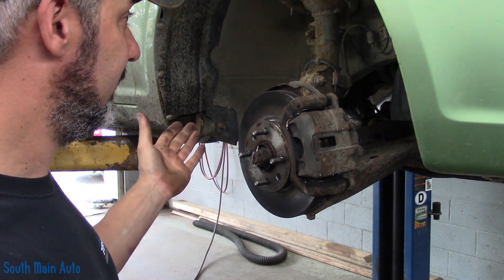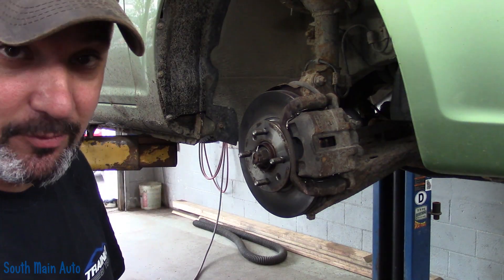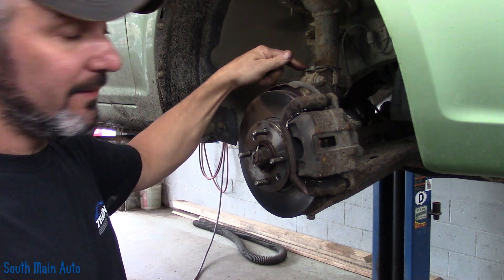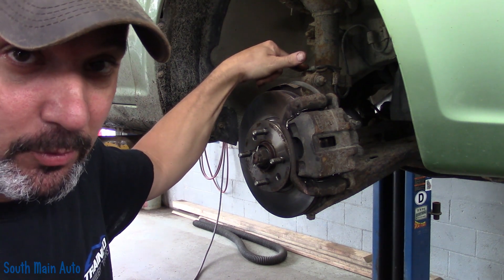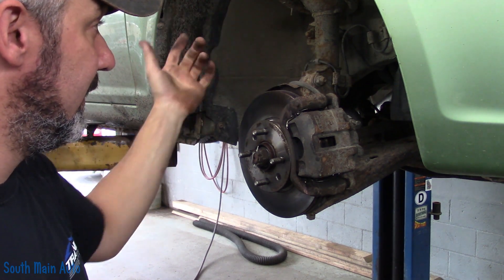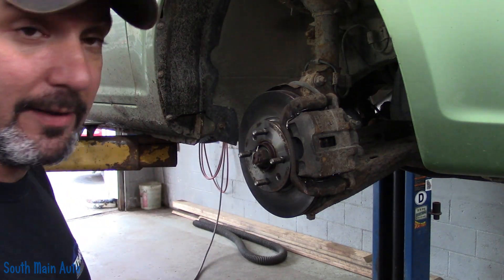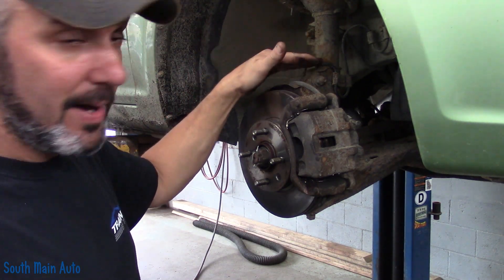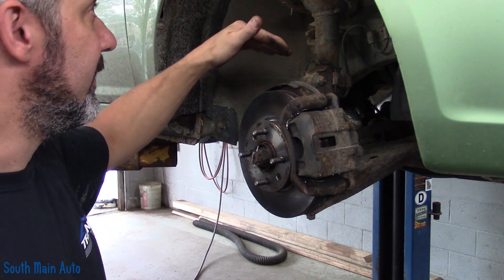Why am I at the wheel? Well, this car does not have ABS; however, it has one wheel speed sensor on the right front, this little guy here. The odd part is the speedometer still works — driving on the road the speedo still works, everything works — just has this P0500. I looked on service data, and it indicated a problem with the right front wheel speed sensor, the only one on this car.